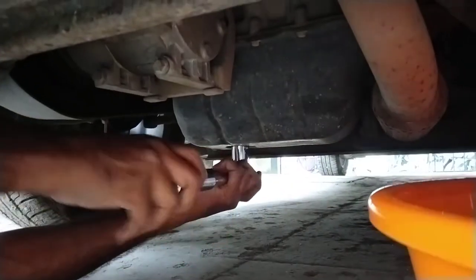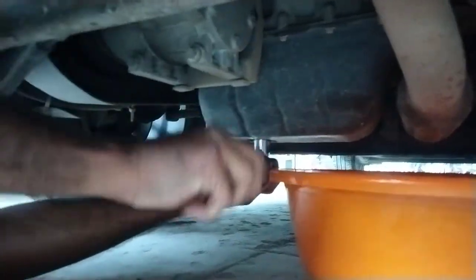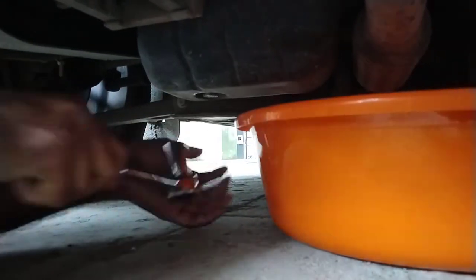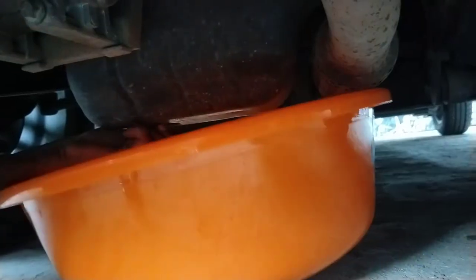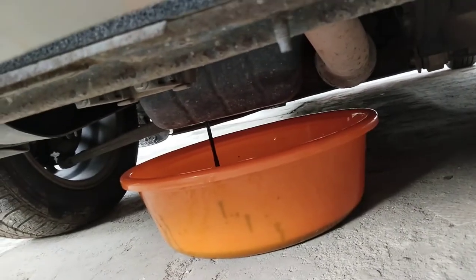In the meantime, let's go see the drain plug location — there it is. To remove the drain plug we need a 21mm hex socket. Removing it is very normal, the same as we do for regular nuts. When you have loosened it about halfway, it's always better to place the oil drainer tub underneath — the orange tub I'm using — so no oil spills on the ground. Try to catch the drain plug as you finish; I just missed it and it fell into the oil sump, but we can take it out later.